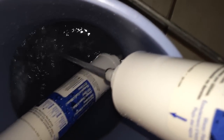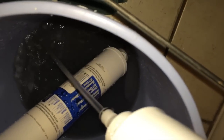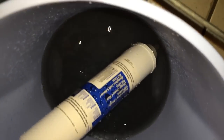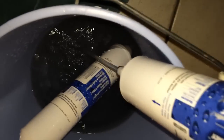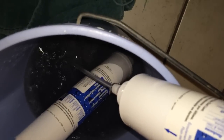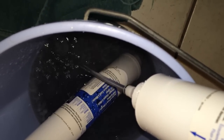I'm running the water straight into a bucket that I can dump outside. As you can see, there's quite a bit of charcoal in this filter, and by flushing it out you're not getting all of that residual charcoal in your refrigerator — it won't be in your water lines or your ice maker. It's also a good idea to let the ice maker run for a good 24 hours after you do this and dump that first batch of ice out, so that if there's any residual charcoal in the ice, you're not using it in beverages and things like that.